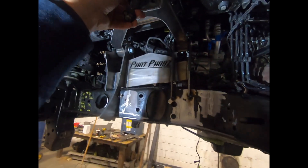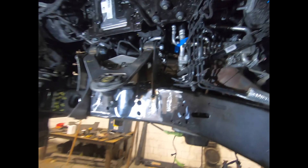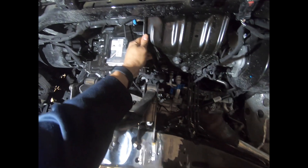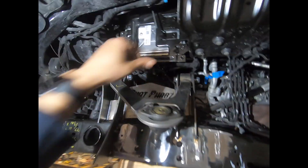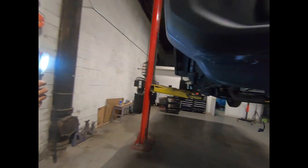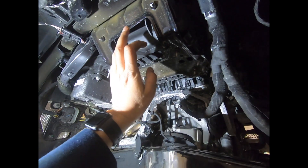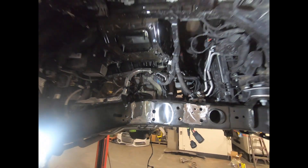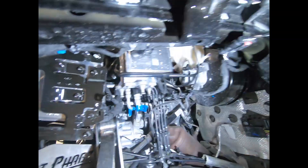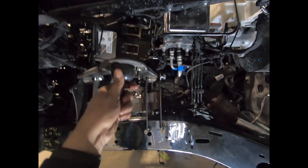So last week we tacked these in just to see how they sit. We're thinking that once the air is down and this Jeep goes on the ground, this is gonna hit. This is where the ABS module is right now, so we're gonna move this bracket out of the way and test if it's gonna clear the computer. On the passenger side, we're gonna take out the battery mount and relocate the battery afterwards. So far we got the bracket out that holds the ABS module, and as you can see now when this control arm goes up it has a lot more room.